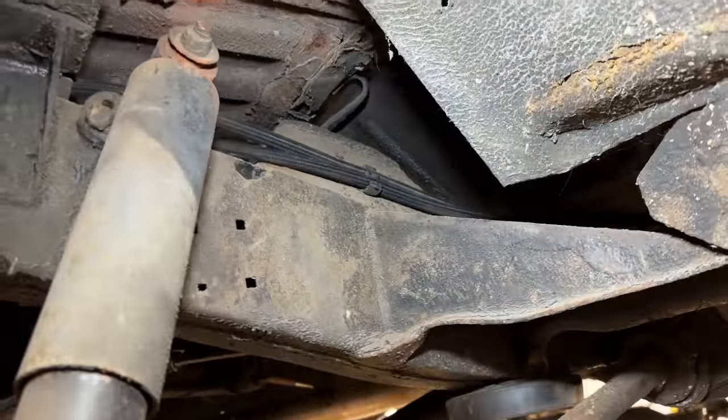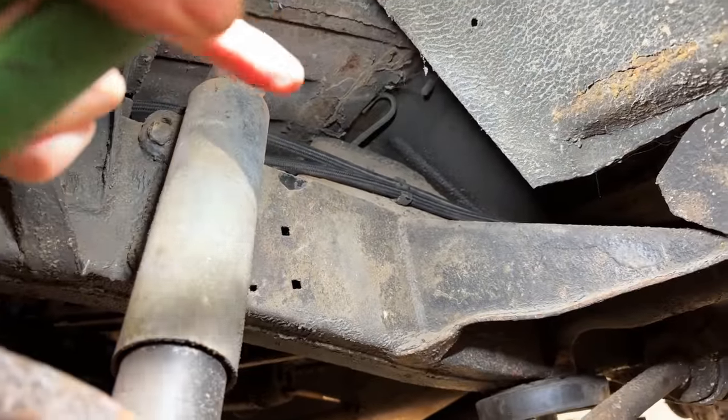What you've also seen me do there is make up the fuel lines, clip them in the original P-clips. They're a little bit tighter than usual, so I'm hoping that one will run. If not, we'll just swap it out.